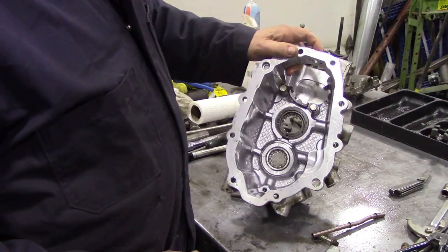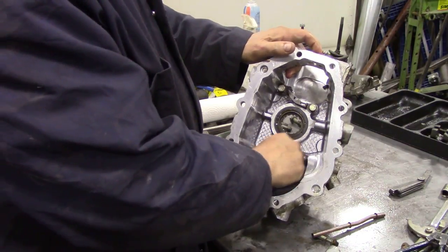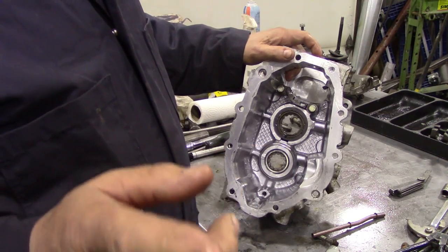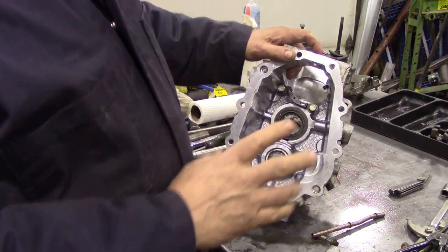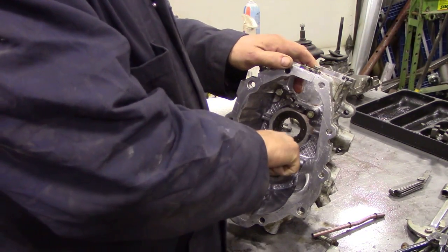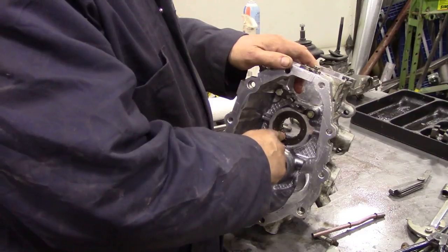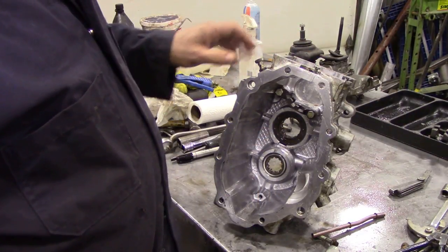I think I mentioned before, the bearings, if they're alright, try the shafting, try the little roller in there, just inspect everything. As I mentioned, because I'm doing this video the day after I did the other one, so I can't really remember what I was saying. But I'm not taking this piece out because these break, but again, if you do take it out, go to Ashcroft's and get the better one, not the sort of original one. They do an upgraded one which is an awful lot better.